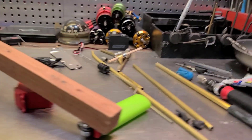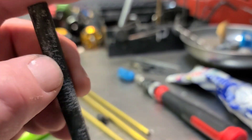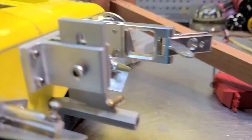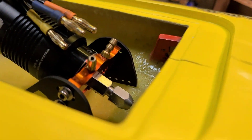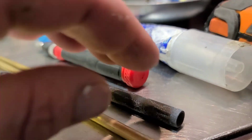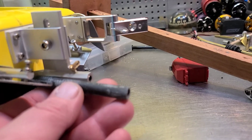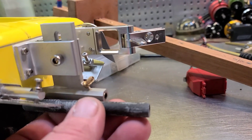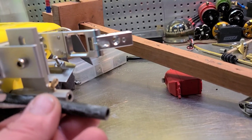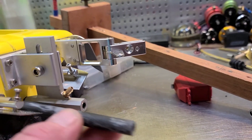I've never done it before so I'm kind of scared to do it. I don't know if this is the right size tube — it's a fiberglass tube, it's a broken fishing rod that I cut, and I thought it might work. It would just give me a little bit more tunability with this boat. A flooded stuffing tube would really allow me to tune this boat much easier. That's one of the advantages of running the strut on your RC boat — with a flooded stuffing tube you can actually get up and down adjustability on your strut, whereas with a stinger you couldn't do that.